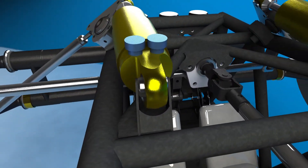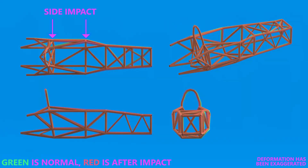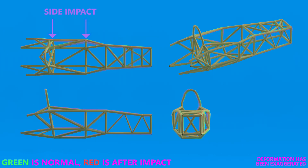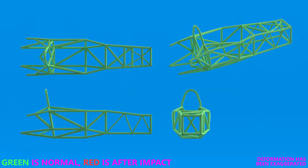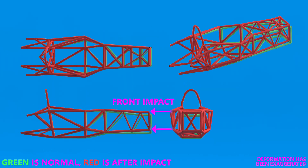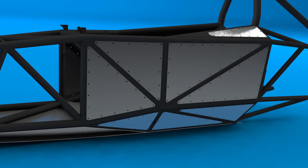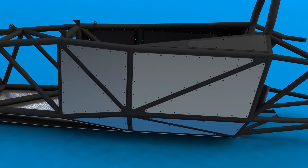Also critical was making sure the chassis itself was strong enough, even in the event of an impact. I used a finite element analysis model I had written in Microsoft Excel to do this. It was simple but gave me some guidance on where the chassis was weak and where it was strong. The car ended up being very strong, mostly thanks to the rules-specified member sizes and positions around the cockpit. In reality, the side impact protection plates required by the rules — but not included in the analysis — will add significantly to the stiffness.